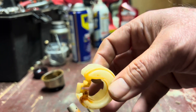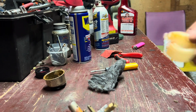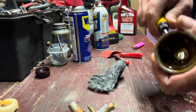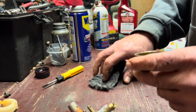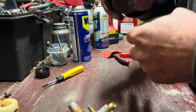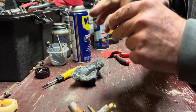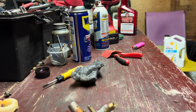This one here is looking pretty good. I've got to give it a little more cleaning, but I don't think that's going to be a big deal. Now, the float bowl — go ahead and pop the drain off of there. She's a little rusty in there, but I don't think it's to the point that it's going to be anything major. I'll go ahead and give her a good quick treatment with fine steel wool. There's still a little more to go. It's not bad, but it's not that good either. So that's where we're going to break out the Dremel.